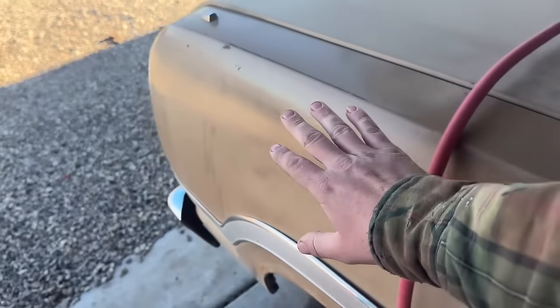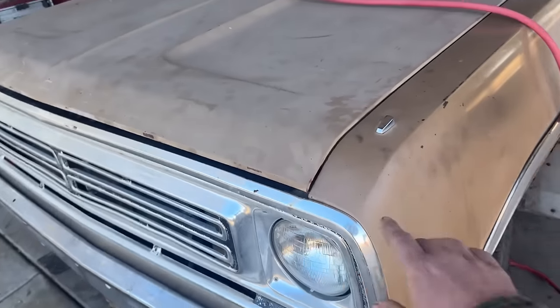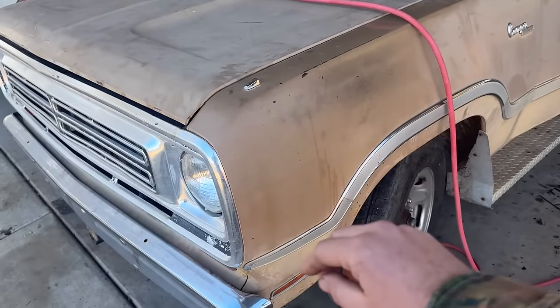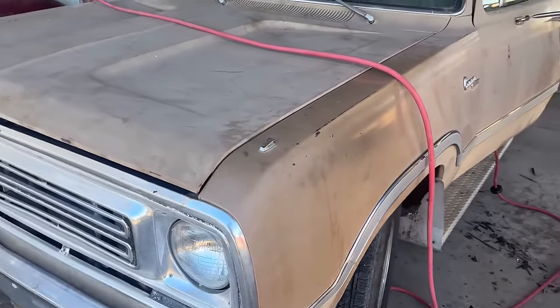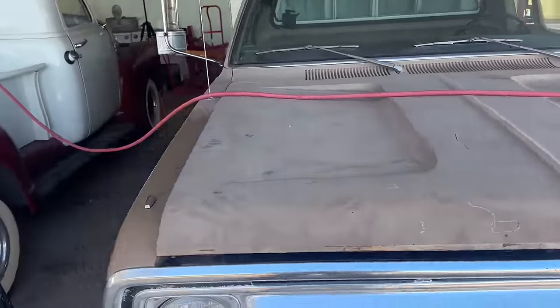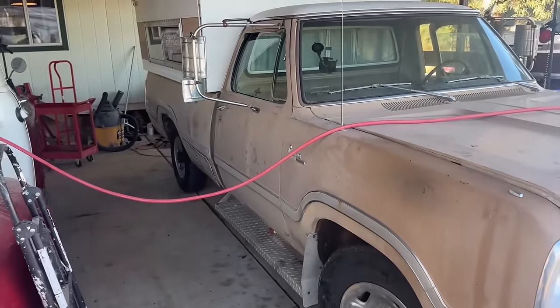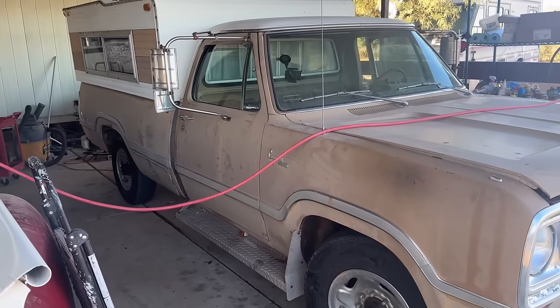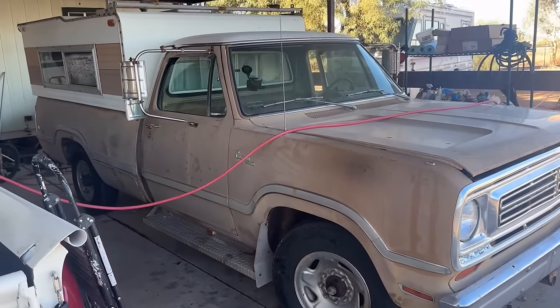And after that, we are gonna deal with the paint. So you can see we've been leaning over it right here, working in the engine, and you can see how nice the paint actually is. We've sanded it off with our jackets, you know, bending over it. But the rest of the paint job is chalky, oxidized, but it's all there. What we're gonna do is clean this paint up. We'll maybe sand it with some 1500, we'll polish it out, we'll make it look basically like a brand new truck. It'll be really nice. So once we do the floor, put the carpet in, put the seat in, make the interior nice and complete, bolt the dash back together, fix the paint, we'll be really coming down the home stretch on this thing.